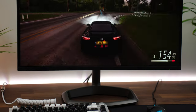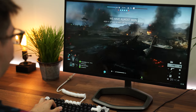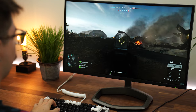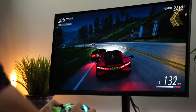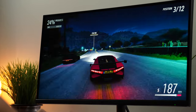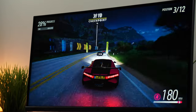As far as user experience when gaming — because there are so many zones — this is more comparable to an OLED than a VA panel, and the overall consumer user experience is very similar. Heavy enthusiasts will keep pushing OLED, but you're missing the point of OLED burning in and degrading over time. An IPS panel is just going to be as reliable as it gets. With mini LEDs, you're having blacks that are really close to an OLED and you'd be able to keep this panel for 10+ years without any burning.